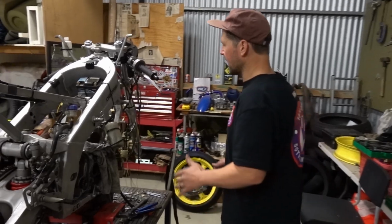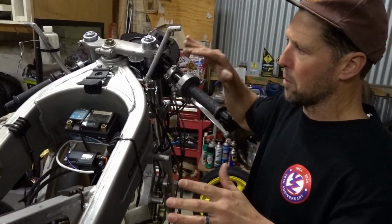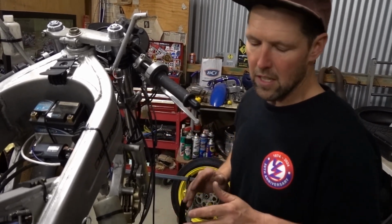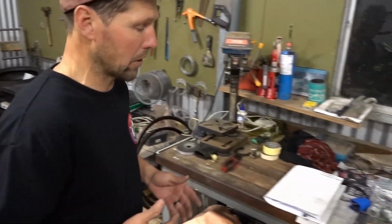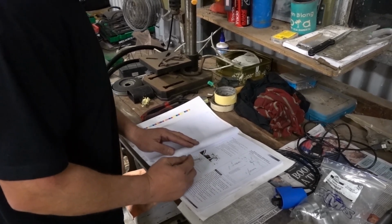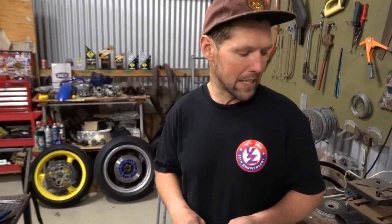Alright, so we've got the two legs back in. Now, when I was racing the bike I had certain settings in the triple clamp and stuff, and the bike was feeling okay. But look, now that I've got new setup in the forks, what I'm going to do is just go back to standard Yamaha geometry settings. So in their owner's manual, they actually give you all of the bar heights and how far the forks go through the triple clamps. So what I'm going to do is just go back to standard fork tube through the triple clamps. So they're saying 21 mil through the forks. So I'm going to start there, then do a test day, fill the bike, and then change from there. So either it's too aggressive on the front, or we'll see how it feels. So it's a good start line, and I reckon we should be able to progress from there. So we'll start from standard settings.